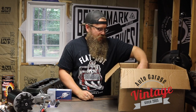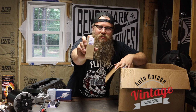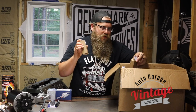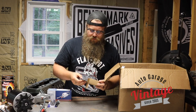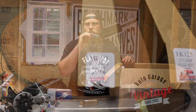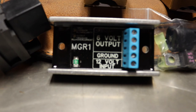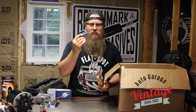Vintage Auto Garage builds a lot of their stuff in-house right here in America. I love grabbing their boxes and seeing the Made in the USA logo on them — that actually means a lot to me. One thing I really, really like and use on everything is this multi-gauge voltage reducer. I did a whole video just on this, so check that out. This takes input from the 12 volts and gives you an output of 6 volts, so you can step down and protect all your gauges with just one item — you don't need to buy an individual piece for each gauge. This makes the whole process that much easier.